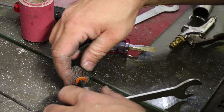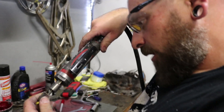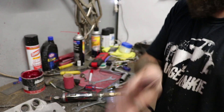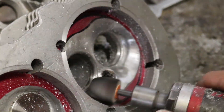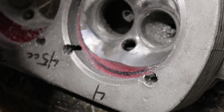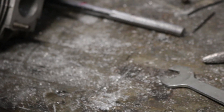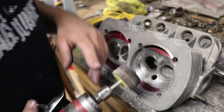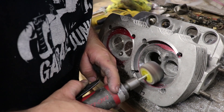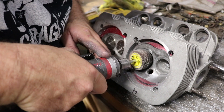Alright, flappy disc — this looks like a 40 grit flappy wheel. I'm covered in aluminum. So you still got a little bit of ridges in here. I'm going to hit it with the bigger wheel, which is 60 grit — the other one was 40. It's a finer grit to polish it a little bit better. And then after that, I hit it by hand with the 180. If I had a finer grit wheel I would do that, but I don't.